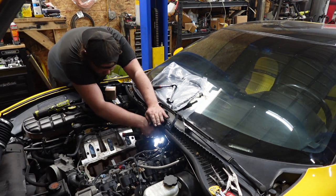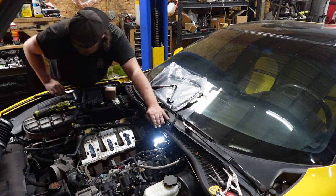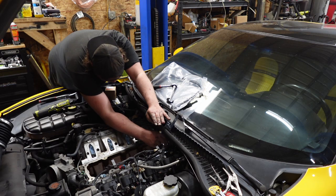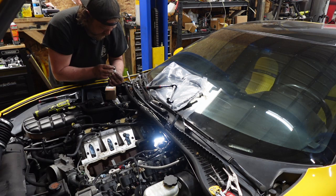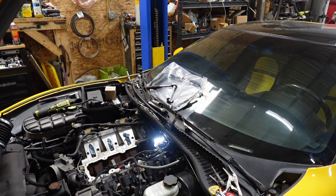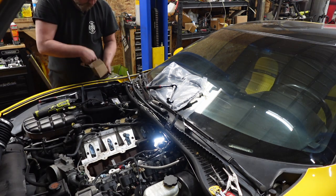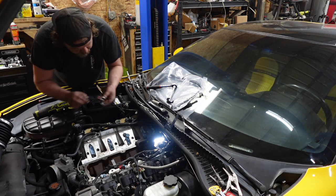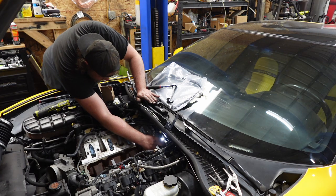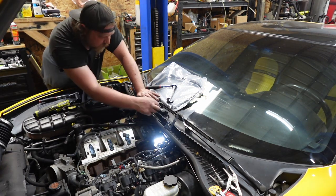All right, guys, while I'm here, oil pressure sender. Loosen. You need a special socket you get from O'Reilly's or any of your parts houses for these things. Unscrew it. I don't know if it'll focus, but there's definitely oil in there. So she was bypassing. New sending unit. Same thing, we'll just put it on and snug it up. Installation is the same as uninstallation, but actually, let me clean around that bung, and we'll snug that in.